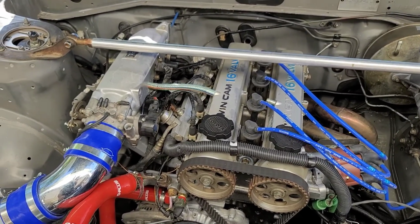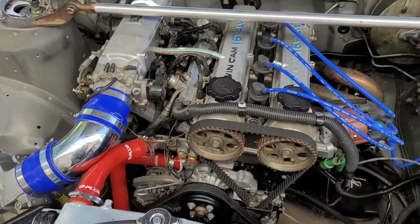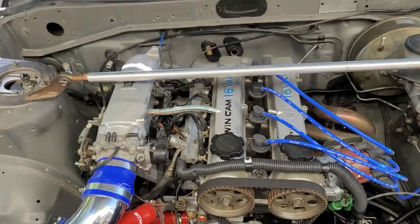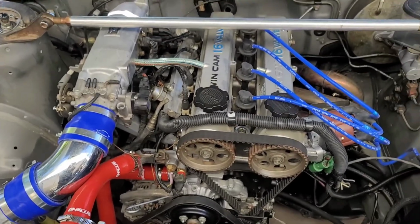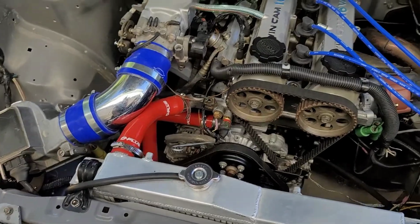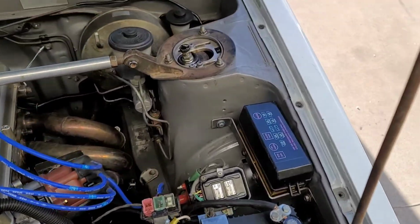I think on eBay they sell a kit that eliminates the resistor pack, and you can run high-Z, newer style injectors. So I'm probably going to go that route. I just have to order the parts. It's not too expensive, like $160. You get four new injectors, newer style, and you get to eliminate the resistor pack, which is all good for me. That seems like a win.